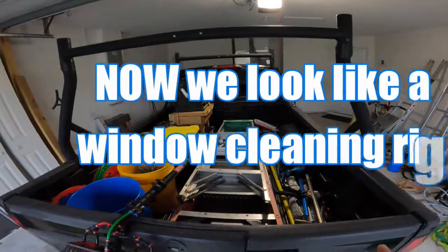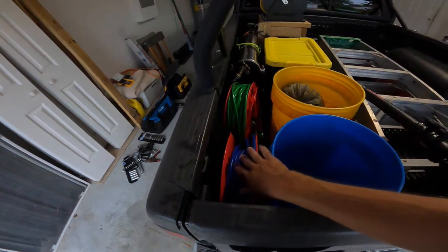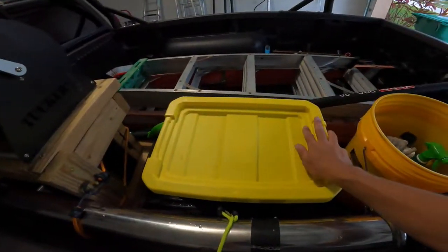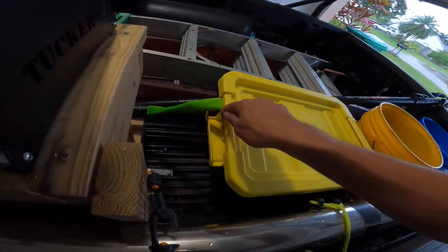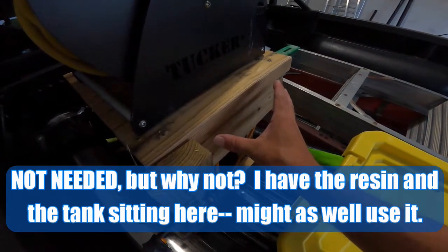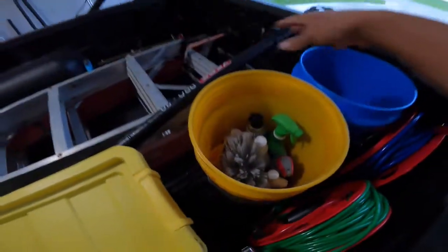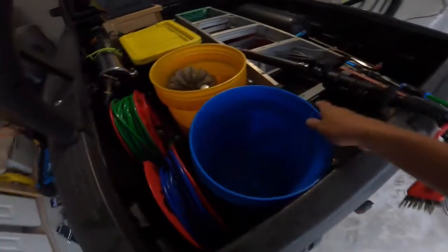Everything's put back up — very simple to use. I've got 70 feet of the Viper hose quarter inch, and 150 feet of the five-sixteenths standard hose. My hose is stored in here in a nice bucket — I'm going to drill out the bottom so water can drain. Here's going to be my final DI polish: a 10-inch by 4.5-inch Big Blue tank with a deionizing filter. I have all the room here — all my chemicals, anything you could need is back here. I'm going to get a lid for this to keep it dry.